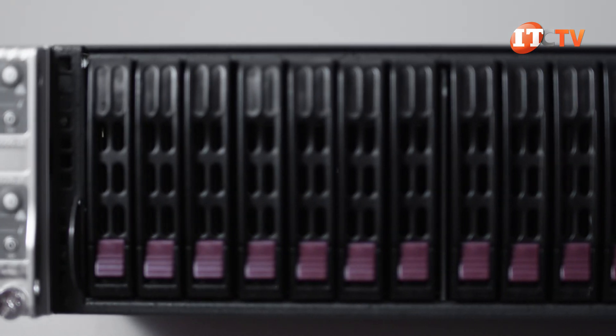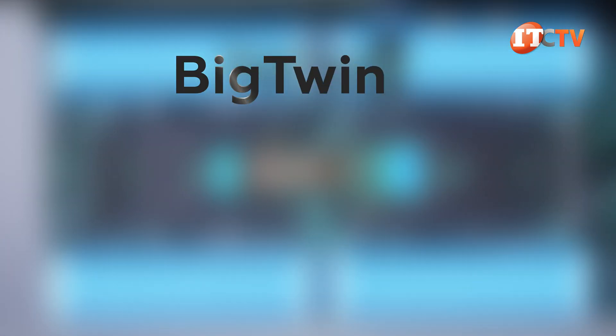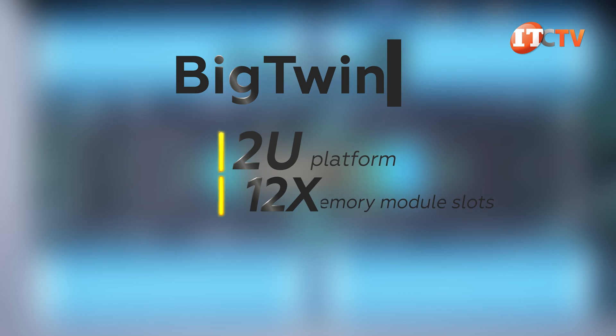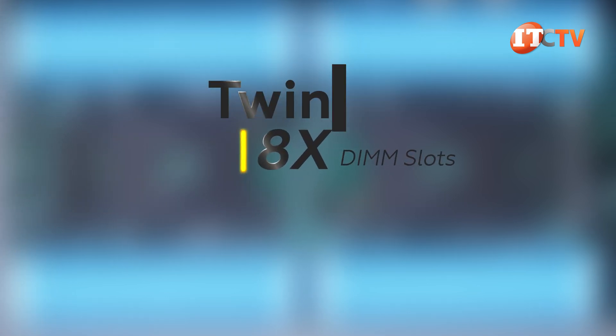Many of these systems look very similar, so I will offer this as well. Twin Pro systems like our unit here have 16 DIMM slots per node, which is the same as the 4U Fat Twin. The Big Twin, on the other hand, is the highest performing 2U Twin platform and supports 12 memory module slots per processor — 24 memory module slots total with both processors installed. The Twin supports only 8 memory module slots per node.